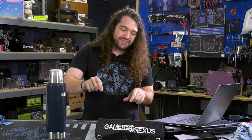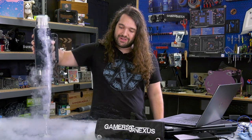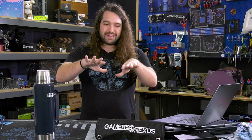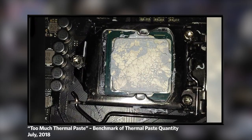Just empty the whole tube. Now, generally speaking, I like to do just an X. We do a lot of extreme overclocking — there's liquid nitrogen on the table — and I've found that you can manually spread the paste, which helps a little with extreme overclocking. But for a normal PC build, doing an X on a CPU and applying the cooler allows me to get CPUs up to like 5.8 gigahertz, six gigahertz sometimes, no problems at all. You're really just going for full coverage and making sure there's full spread of the paste.